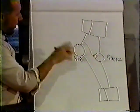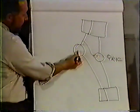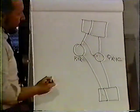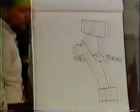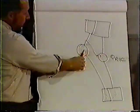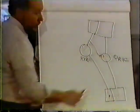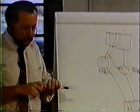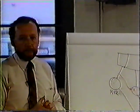When we were parked, there was no air in any of the chambers. We put our foot on the pedal, we activated our R12 valve. That sent air into the service chambers. At the same time, it sent air into the quick release and into the spring brake chamber. Brake on, brake off. Foot off the pedal, air is exhausted from both sides. Brake off, brake on. And that would be our anti-compounding. It's a safety feature. It will also save you time and hassle in changing damaged foundation brake parts.